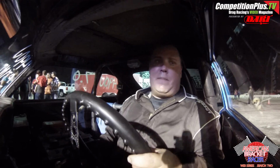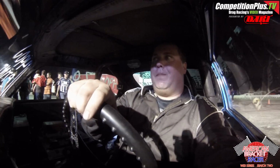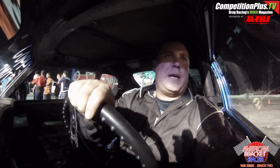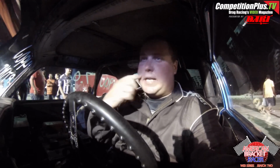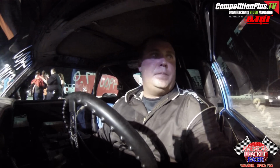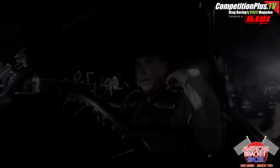So I might take a little bit more turns out and make it go a little faster, that way I'll be breaking out. I'm not cutting really great reaction time, so I might have to take a bump in anyway. If I bump it in 2 or 3 inches, that should shave off about 30 off my light, and then I should tag it better as the rounds go on. I'm getting a little more pumped up, and we'll see. Going into the second round, a 7:0 index next.